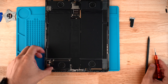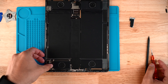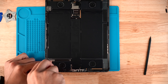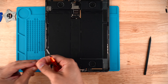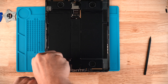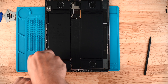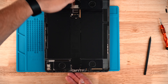Once those screws are installed, plug the ribbons back in — place your thumb over the top and push down, you should feel it clip right in. Do the same for the one below. Then take the little plate and install it back into place, fastening it down with the screws. These screws are very small — if you drop them you're not gonna find them. But one missing screw won't cause harm; four screws holding the plate is just as good as five.